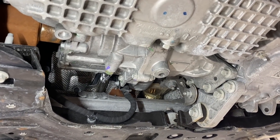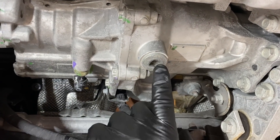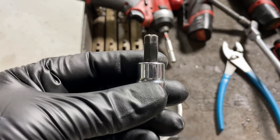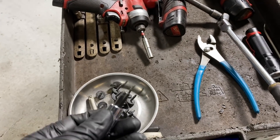Servicing this PTU is very simple. There's a drain plug right here with a 3/8-inch drive for your ratchet, and up inside here is the fill plug — it's an 8-millimeter hex. Make sure you have an 8mm Allen wrench or hex socket on hand before you get started.